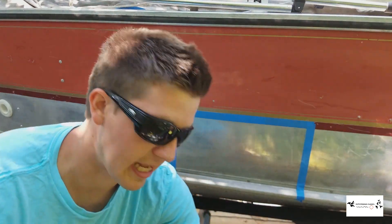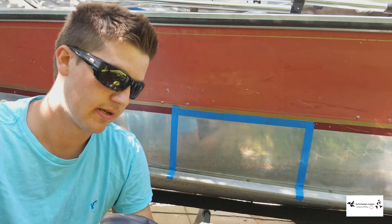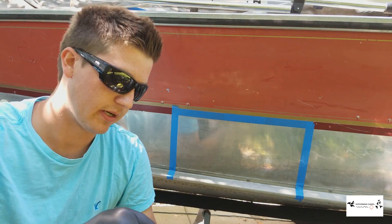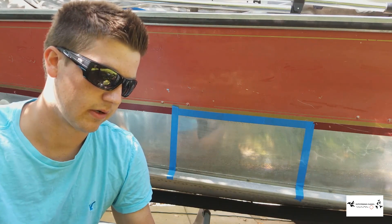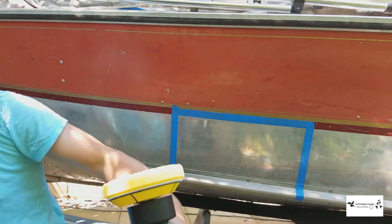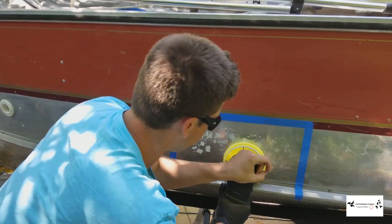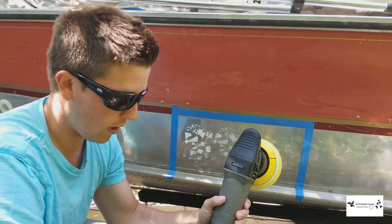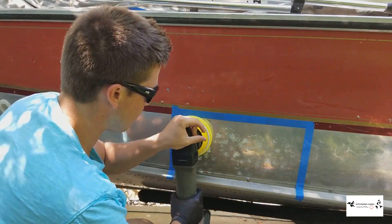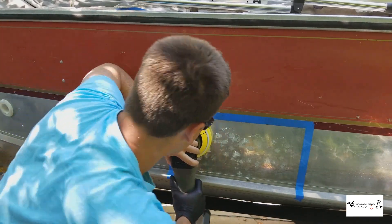All I'm going to do is take my yellow pad and put a couple dabs of polish on it — not too much, maybe a little bit much there. Spread it in a bit. Then put the polish aside, press the pad down onto the boat. It's a pretty stiff pad so you can't press it too much. I'll start on speed setting one just to make sure I can spread it in. Make sure the pad is touching the boat before you start, otherwise you get polish everywhere.